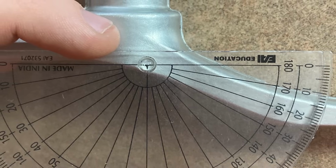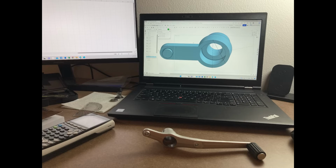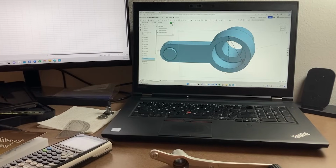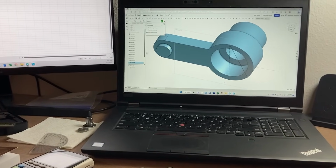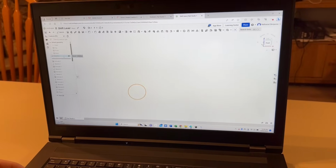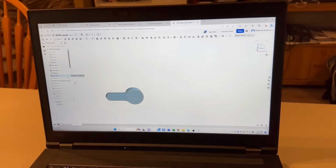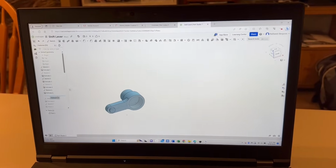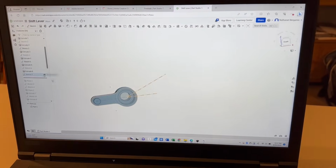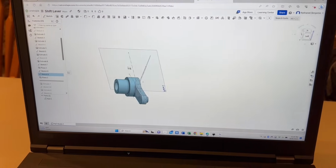Here's my brother figuring out the geometry of the shift lever with tools you probably used in grade school. As you can see from these photos, the Fireblade shift lever is three-dimensional. That means it's on an X, Y, and Z axis. And now, here is 50+ hours worth of work in the CAD software from my brother. He had to make sure that the holes for the shift rod and where the shift lever was mounted to the frame were precise so they would function just like factory.